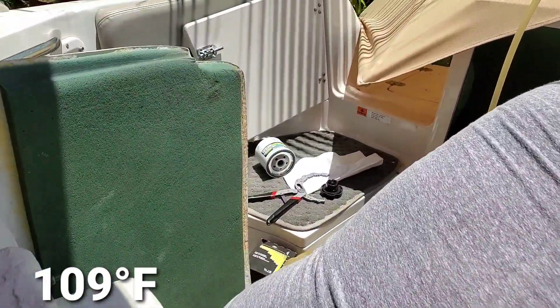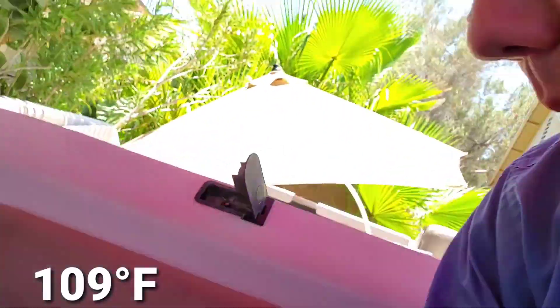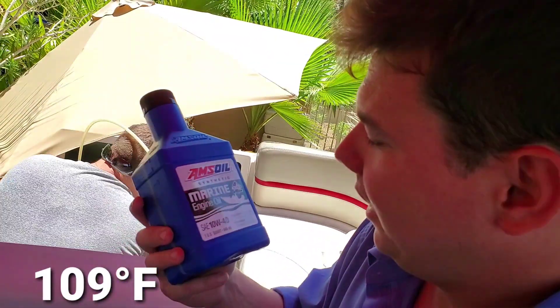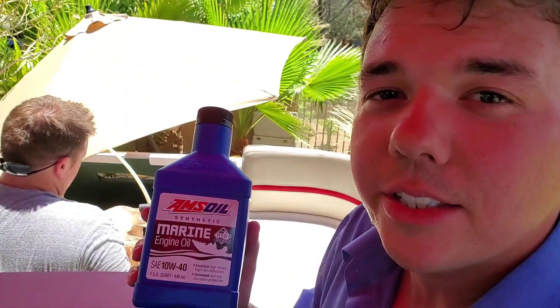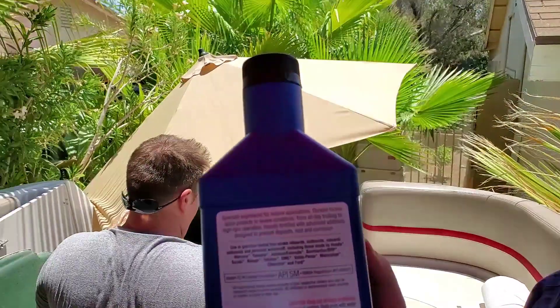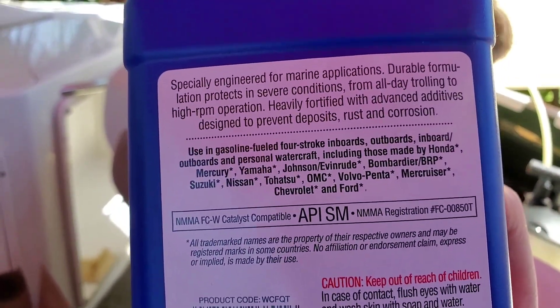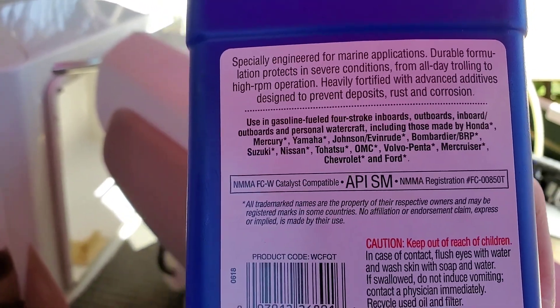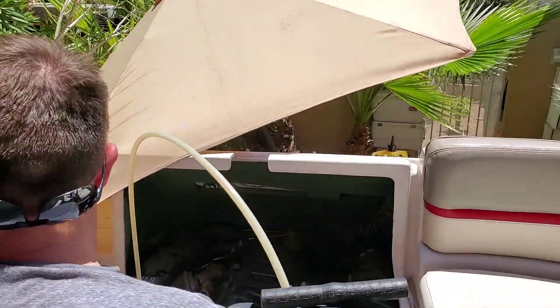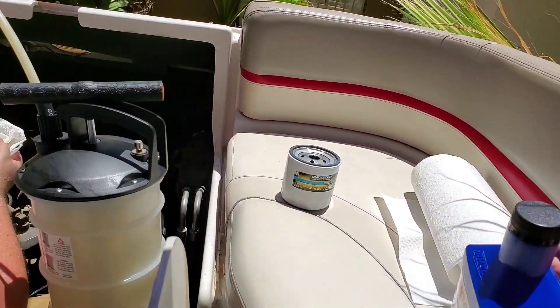We're going to lube up our fresh filter. We're putting in a really good 10-40, which is a great intermediate weight — not like a race engine 50 weight, and not a super gas mileage 30 weight oil. This is right in between with tons of protection. This is actually the original viscosity AMSOIL came out with back in 1972 — the API certified was basically a 40 weight, the very first in synthetics. This meets and exceeds all API certifications and will not void any of your warranties. It'll be good for about double your OEM interval — the biggest weak link will be the filter.